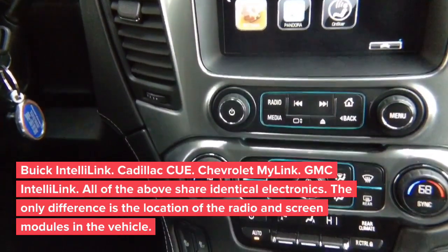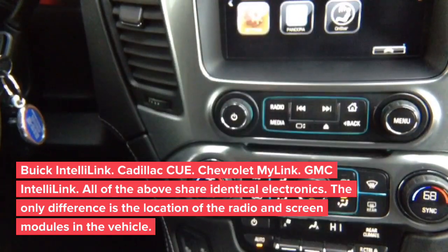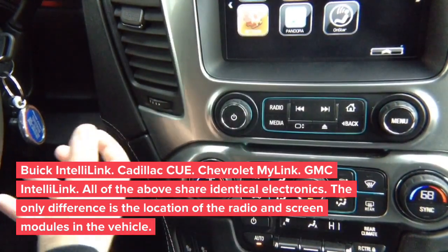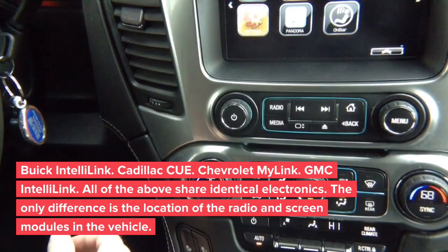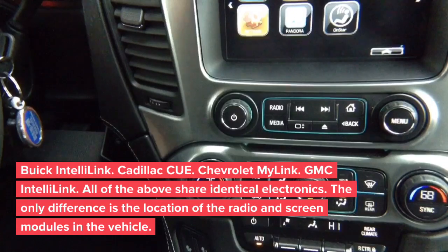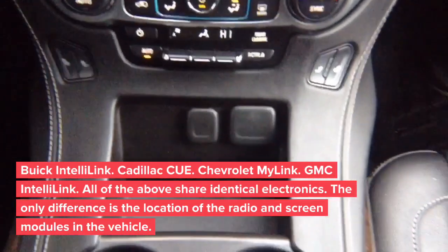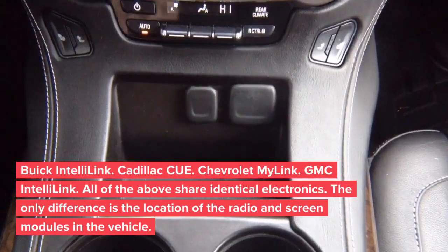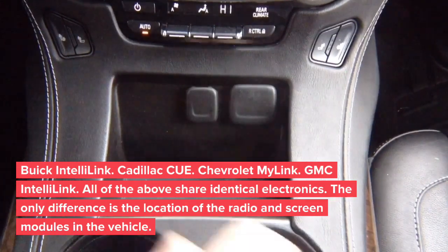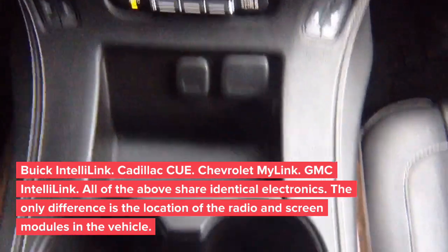you got the bottom kick panel, the dashboard panel right here. So this panel, this whole dashboard panel needs to be pulled up a little bit. There's no screws again, just pull it up to open it a little bit. And once you pull it up, when you pull this panel up, you'll be able to basically pull it out from underneath that panel. So what you're gonna do is you're gonna start by pulling it anywhere, grab it here, anywhere. Better to start here,